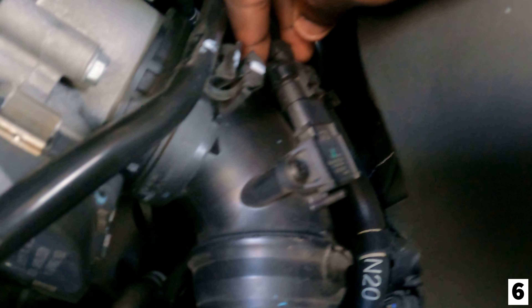There's another sensor on the bottom. That's the C-clamp right there. Now it's off the throttle body — as y'all can see it just popped off once you take off the C-clamp and get that sensor out. See those ridges? They got ridges on the other side — pinch it together and pull up. If you pinch them they come apart, and it just pops back in. Let me try to take that vacuum line off the bottom.